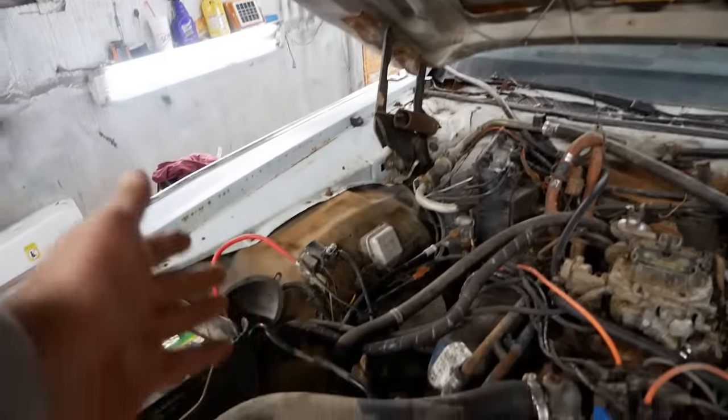Can't believe there's still fluid in it. Oh well. Then we'll just run our new one right through here. Way easier. Nifty little SURR flaring tool. Basically three steps and you make a damn near perfect flare every time. While I make this brake line, I'm going to set JD to scuffing this thing up with a Scotch-Brite. Because we're going to turn it into a cop car, apparently.